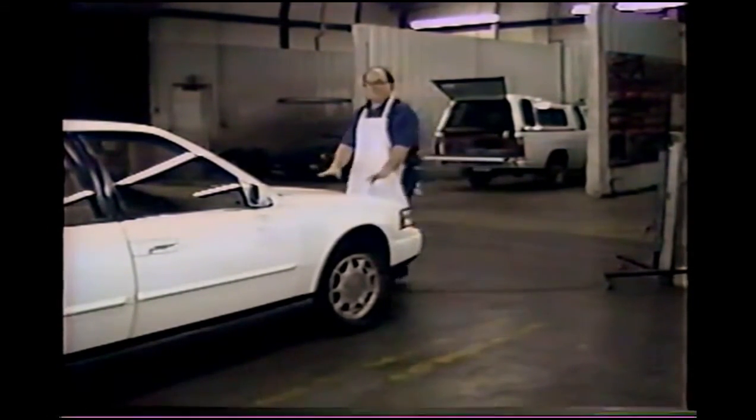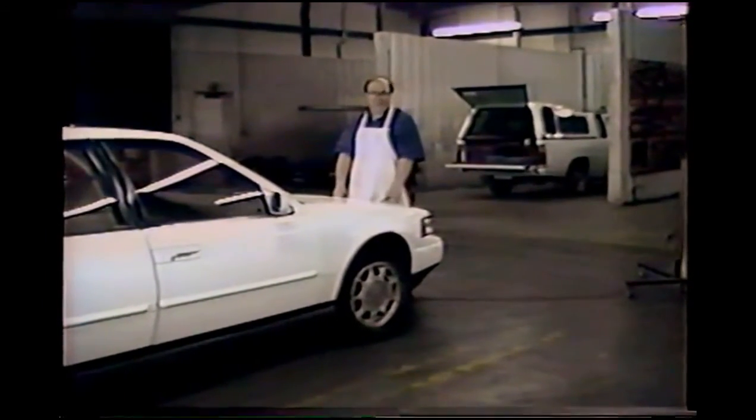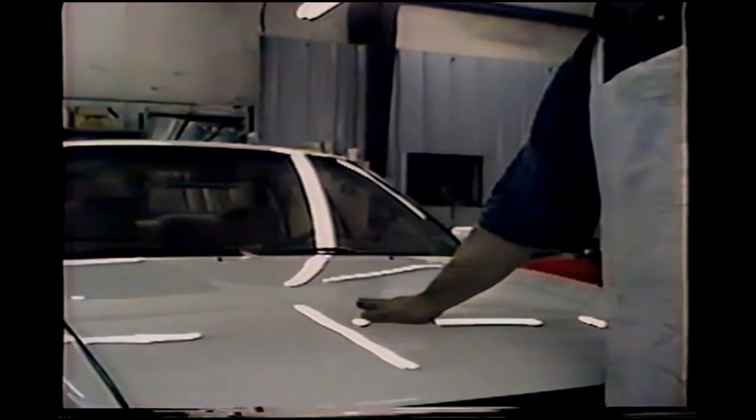The hood is the easiest part. You simply raise the hood, remove the panel, and have at it. You've probably seen some of the type of dents that are a large, shallow dent in the hood. We call them glamour shot dents, imagining that some beautiful model sat on the hood and left a bit of an impression. Now, there's an easy and quick way to get most of or all of this type of dent out. We use the cake cutter. What we do is you simply open up the hood.